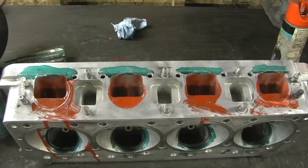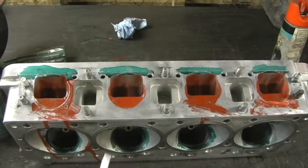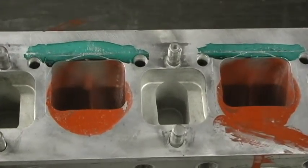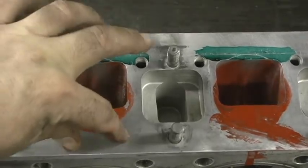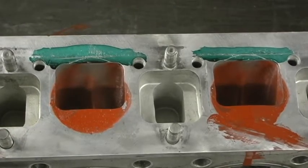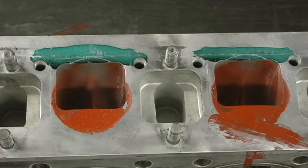This is the result of the headers. Notice we got a half-moon shape right here — doesn't look like there's none at the top. Well, the newer Hemi heads — like I call them newer, the past-generation head — that were all the way to the deck, they raised them up to the top. And what makes me so mad is this is like the wrong header made for this, because they could have come on up on that tube.